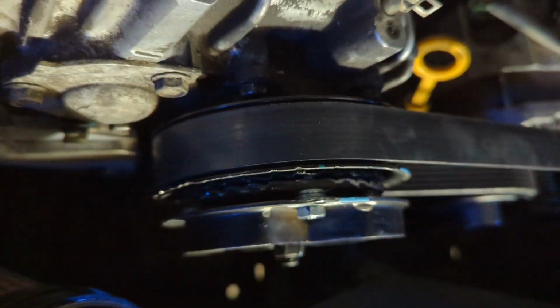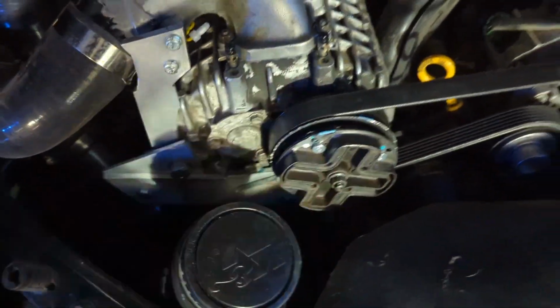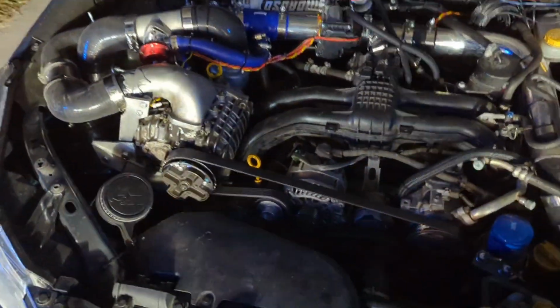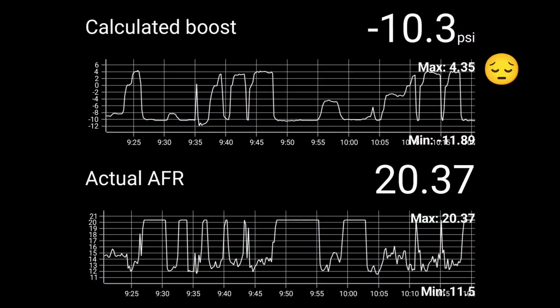So I've officially thrown in the towel on a clutched Supercharger pulley. I have disconnected power from the magnet and removed the magnet. The pulley face, the clutch, is now bolted directly to the pulley. So big question now is just how much boost this makes, and then I'll go from there.